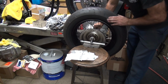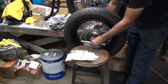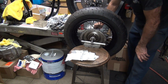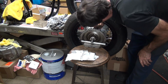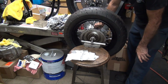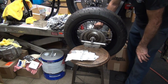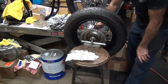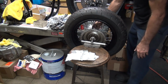Okay, I'm not sure where the weight is, so just turn it 90 degrees. Quit moving. Okay. See where the tire's going. Tire's dropping just a little bit. It's pretty close though. Where's the weight? Weight's way over here. Weight's just a tick light. So instead of a 1/4 ounce, we need probably 3/8 would be too much. We need 5/16 of an ounce. You don't need to make that.